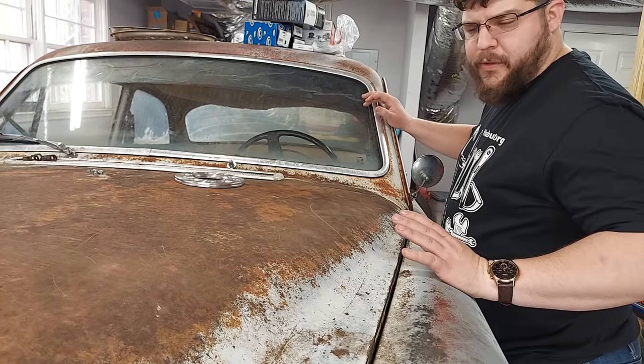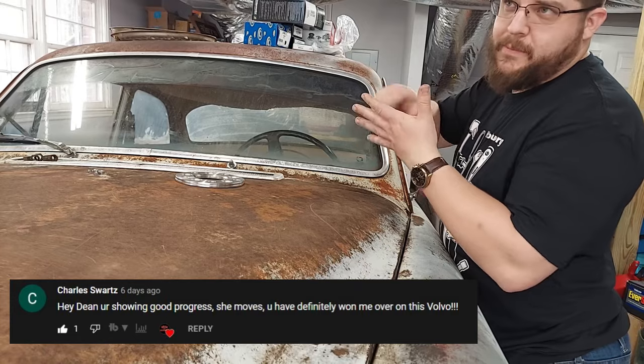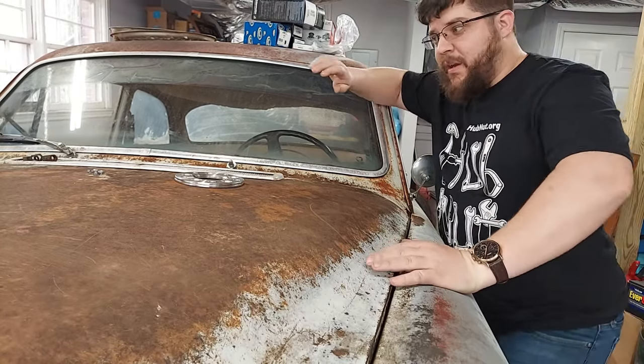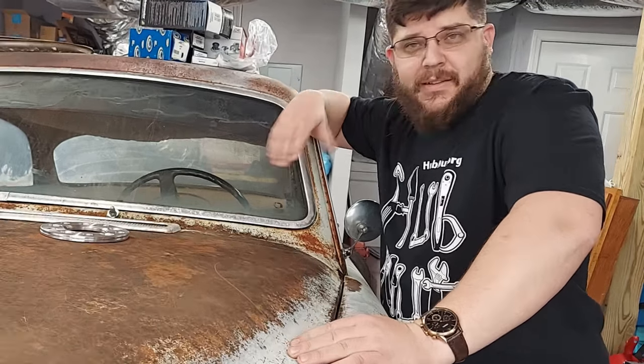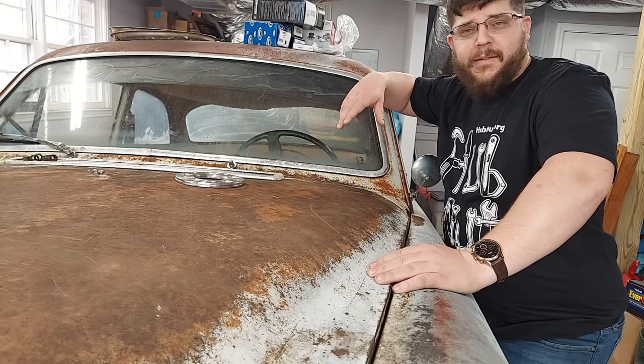We got to deal with these rotors. They're the old style with the wheel bearing that's built into the rotor. So the race is part of the rotor, or at least the bearing is pressed into the backside of the rotor, which means gotta take the wheel bearing apart to take the rotor off the car. It's more fun to see if we can save what's on the car, right? That's the point. Anyway, let's get to it.